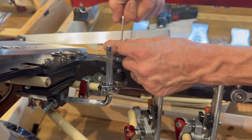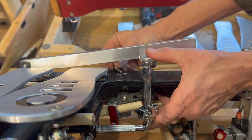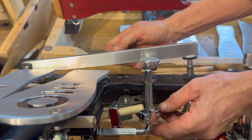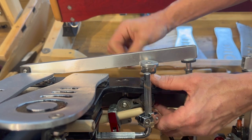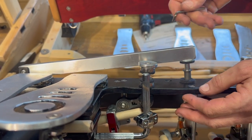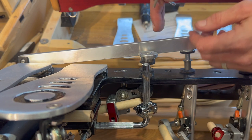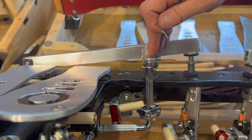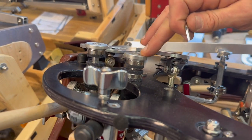And again, if I was reverse engineering, I would tighten that up first, nice and tight. Then I would follow the procedures from the nine to 12-pedal package upgrade video, tightening that all the way over and making sure that's nice and tight. And again, you're oriented towards the back of your wood spine, and it's perpendicular to the drums - there's no turning into it, it just wants to be perpendicular. And that's really your right heel post, your left outer toe post, and your right inner toe post - the six to nine pedal upgrade.